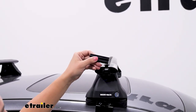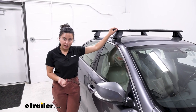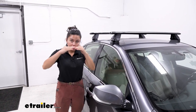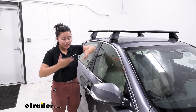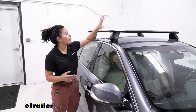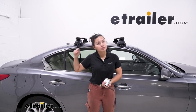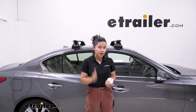That cutting is the downside, so I recommend picking up extras of the vortex strips before or as you purchase your roof rack so that you're ready to go. This offers 165 pounds of weight capacity. You have aluminum bars with struts on the inside, so you have really good capacity in the center of your crossbars — you're not worried about bowing in the middle. Be mindful that this weight capacity includes the weight of your carrier. If you're carrying a heavy kayak, remember to include the carrier weight and make sure the total does not exceed your roof weight capacity.